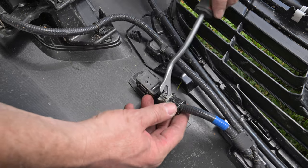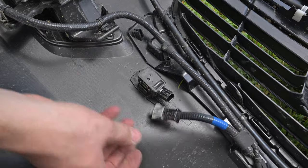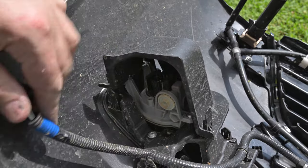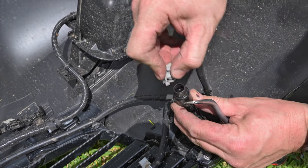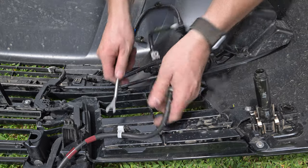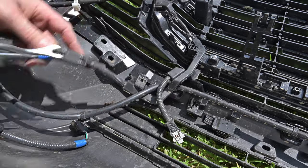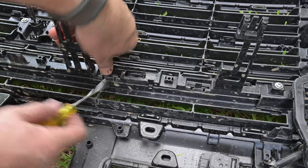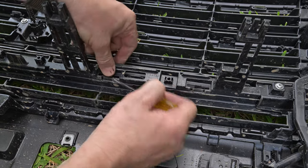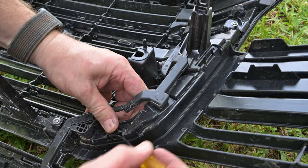It's now time to separate the grille and the assorted cameras and sensors from the bumper. Begin by unclipping the loom from each of the four parking sensors, then disconnect the wiring to the fog lights if fitted. Next disconnect the hoses from the headlight washers. Using a trim tool, work your way across the bumper unclipping all of the wiring clips. You can also remove all the clips from the looms and from the water tubes as the clips won't be used on the new bar. Once all the wiring and tubes are disconnected, disconnect the grille itself with a small flat blade screwdriver by releasing the plastic clips across the bottom of the grille and up the edges.